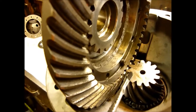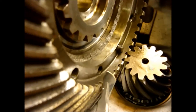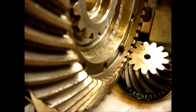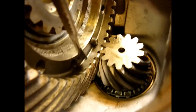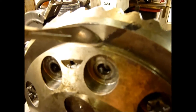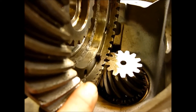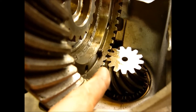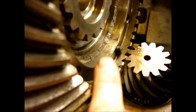Hopefully you're following us now. Here's your pinion and here's the crown wheel, and this is bolted to the centre tube that goes across here — that has sheared off down at this point here. So the centre tube is now missing, and the reason is that before the crown wheel was able to flex away from the pinion. Now what we've done on the far side of this crown wheel — so if you look at the top of the crown wheel and go down inside the casing, somewhere deep inside here right down in the bottom — you've now got a phosphor bronze pad that is pushing against the crown wheel. So when the pinion tries to push the crown wheel away, the crown wheel actually hits the pad and stops. It causes the crown wheel to stay in constant mesh between the pinion and the crown wheel, and that then stops the flexing which has sheared the centre tube off, because this is a very weak point.